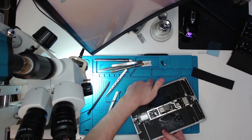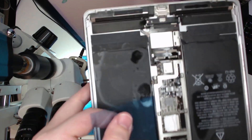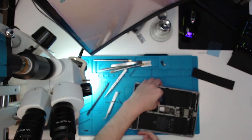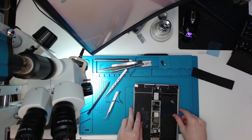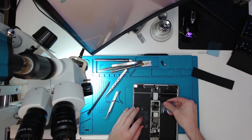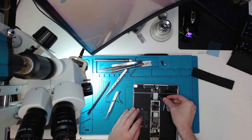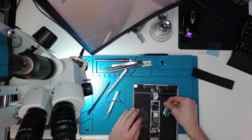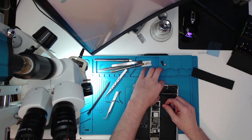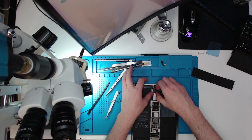Just to show you guys a bit closer — what I've done is I'm working this card underneath the logic board to pry up all that adhesive. The idea is heat's not great for the battery. Using isopropyl alcohol to release the adhesive seems to work best.